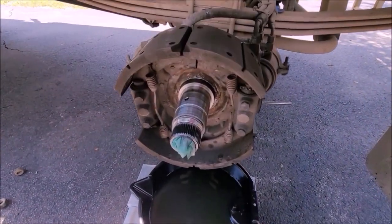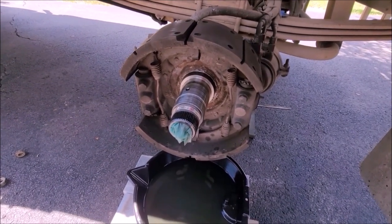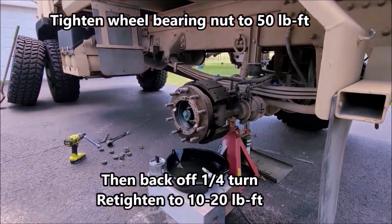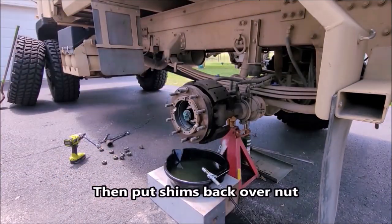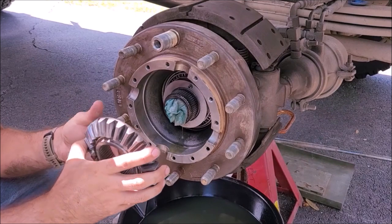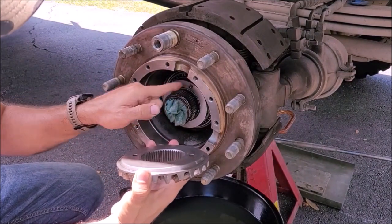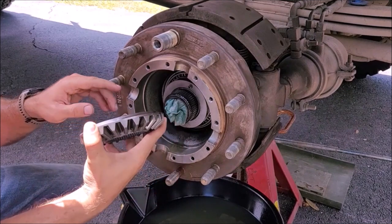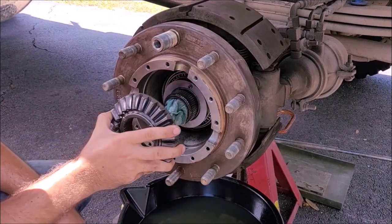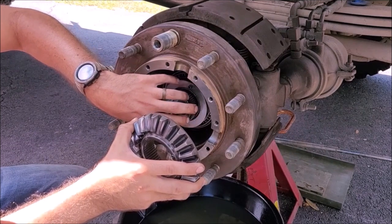Next step's just going to be putting the hub back on, then the outer wheel bearing, and then the nut. After that is when you do the measurements. The next part you got to kind of finesse is sliding the inner gear onto the splines and getting the holes in it to match up with what's on the nut. This is just one of those games — put it on and try your best to get it. I probably should have made a little mark on here and then the gear to get me close, but if you have to, you might need to pull your shims off and then slightly adjust that nut, either tightening it or loosening it.